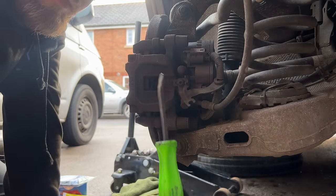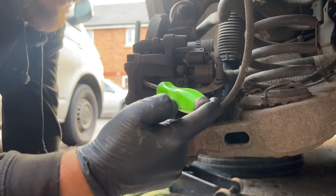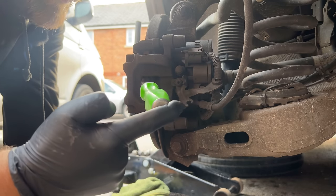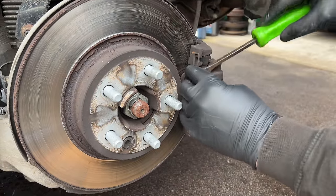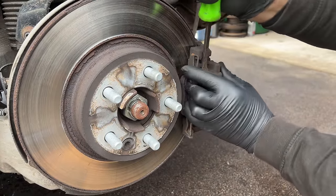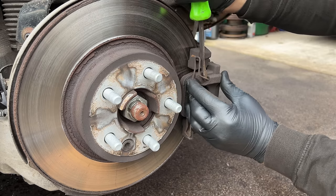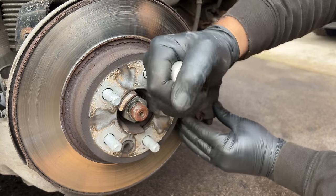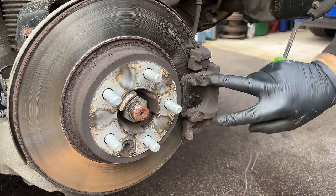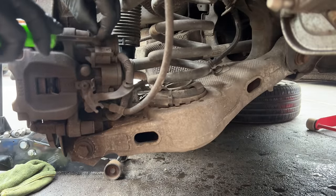Using a small lever bar, just go in here and literally pull the piston back. When removing these springs you'll want to use two hands — lever that one out carefully, but hold on to the rest of the spring because it could come out and go flying. The springs go into those little holes there. Now we want to just push the end cap off.